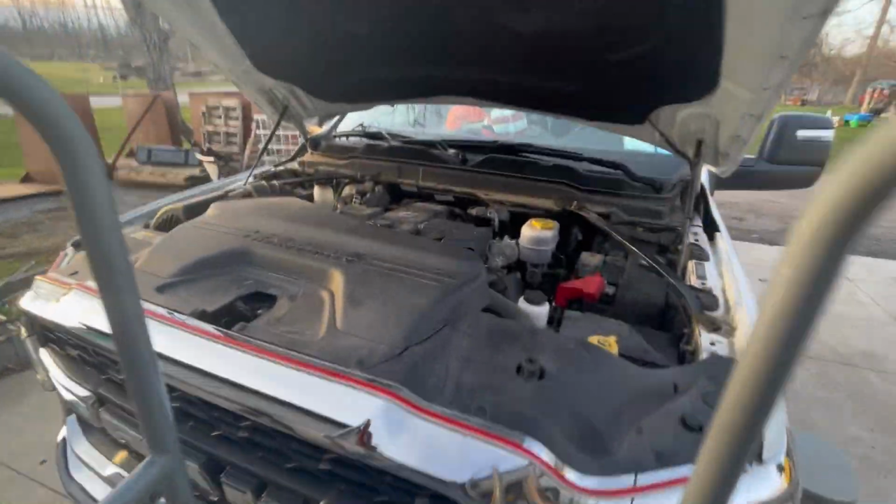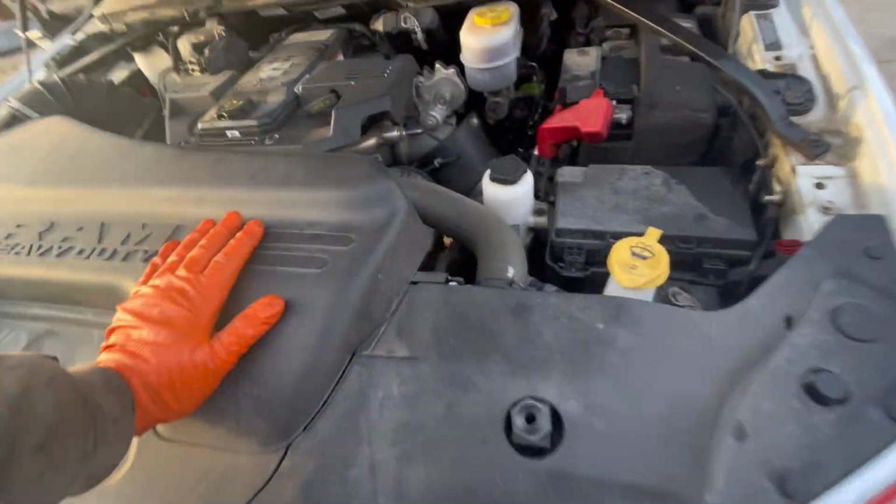You can explain it. So there's a petcock up here. It's a little yellow petcock, and I'm draining the fuel out of it. So if you have any water or debris in there, hopefully it's running out that petcock before we pull the filter out. Looks like there's some water there. It looks like water running out. So we got the petcock draining. I see you had the camera zoomed way in, so I don't know how that turned out, but I guess it'll have to work.